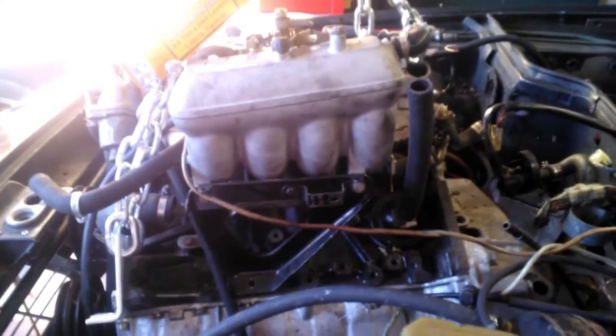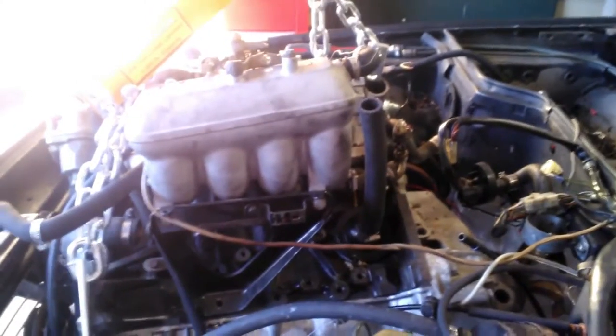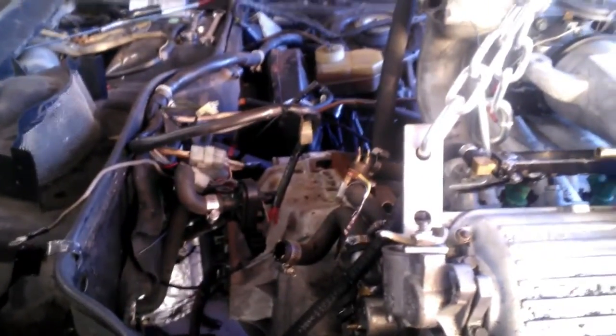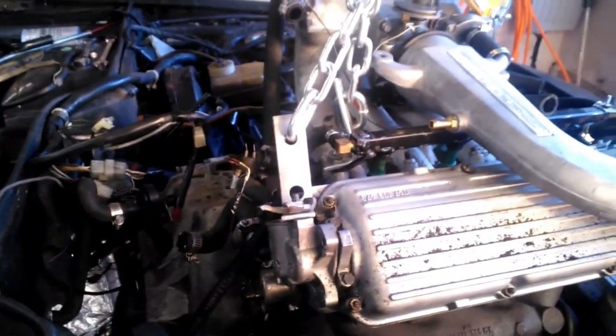And that's really where it got difficult, because for some reason I just figured I'd be able to pull the engine off the driveshaft. But you really have to wiggle it around, because the driveshaft has splines. Since the weight is off balance, you really have to wiggle the engine off the splines and be careful without damaging anything. Once it comes off the splines, the engine just wants to lurch forward, because you're probably giving it a lot of pressure to get it off the splines.